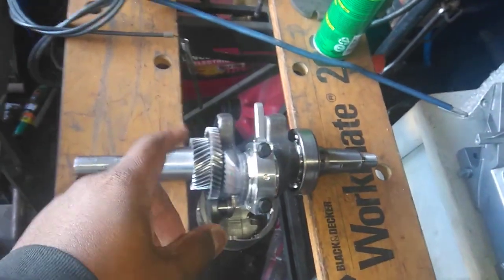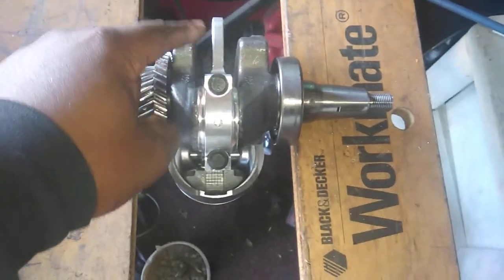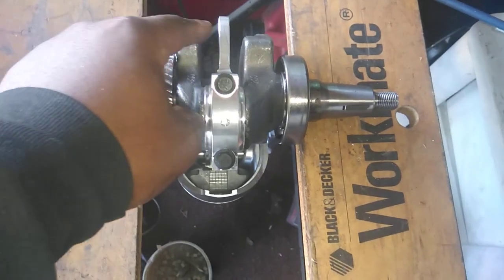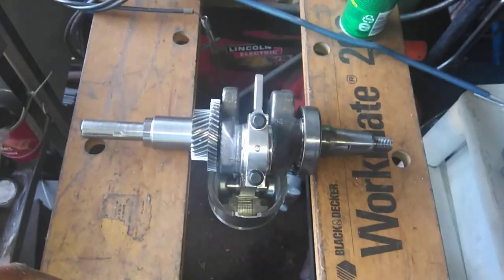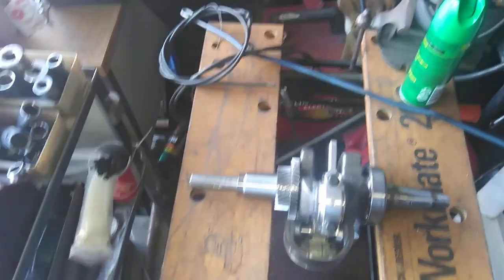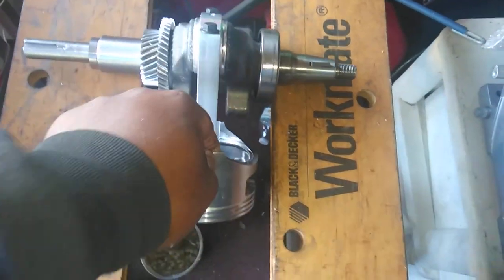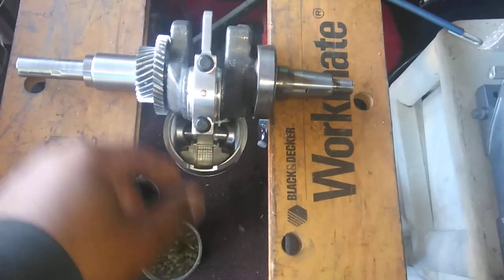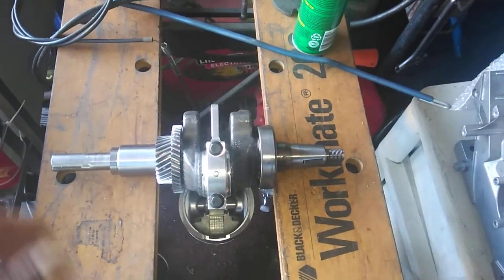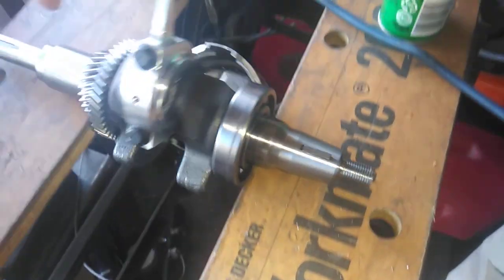What I normally do is put two huge slugs in there, and if it's not balanced perfectly, all you do is grind the counterweights to a knife edge — get some grams off, maybe an ounce — until you get the weight perfectly 50/50. Most people tend to like 55%, some even go 58%. When they say a number higher than 50%, that's the piston side — they want that side to be heavier than the counterweights, including the rod, piston, wrist pin, clips, rings, and so on. Anyway, that's all I wanted y'all to see before I put this thing together.